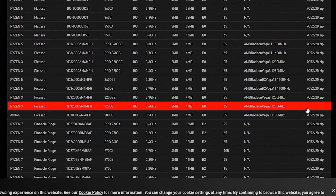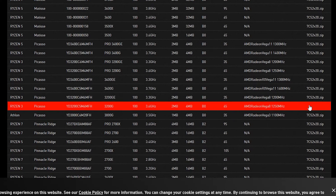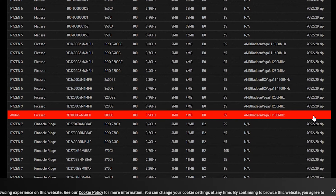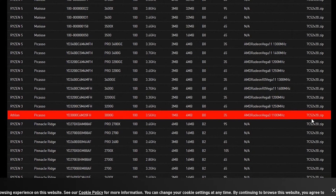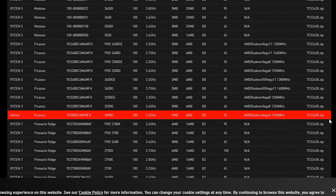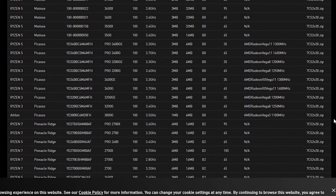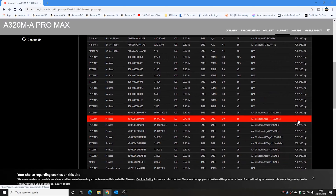The caveat is that the board does need to have a particular BIOS revision pre-installed. If it doesn't have this from the factory, that's where problems arise. You can get Max edition boards or boards with BIOS Flashback, which cost a little more but future-proof you and avoid potential issues. Also, many manufacturers will flash BIOSes for you for a small charge — several UK distributors will do this quite happily.